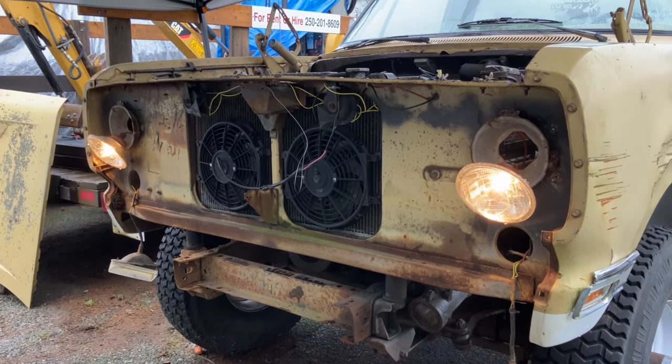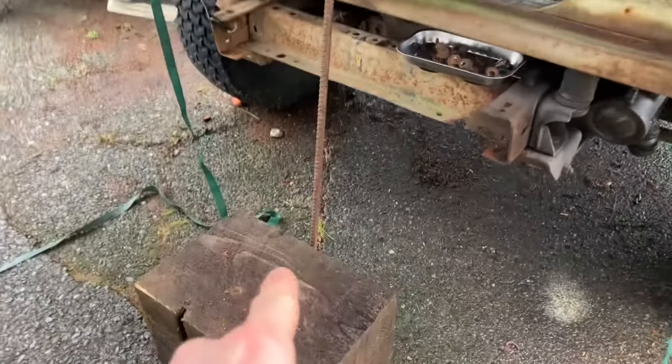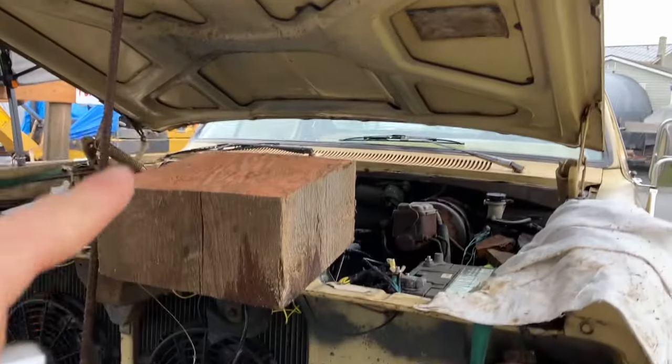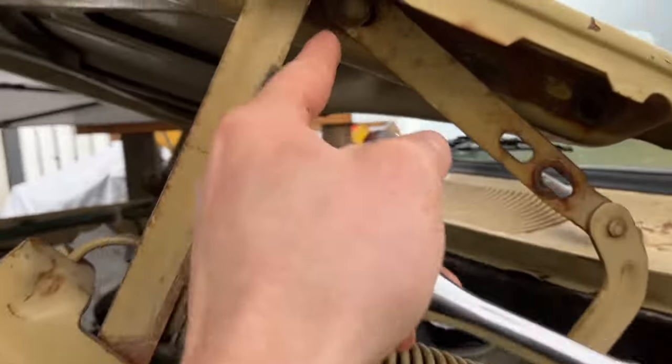Headlights are working. So to wrap that up — I didn't really fix the body line. I actually ended up making it kind of worse, but I did learn a whole bunch in the process. I learned how to take the whole front clip off. Side note: when putting your hood back on on your own, using a piece of rebar is great because it digs into the ground. You can put a block in front of it — it acts as your second hand. It locks in right under there. Before I had the rebar, I just had it on some wood and it kept sliding into the windshield. That block prevents it from kicking out. I got my first bolt in and I'm going to do the same on the other side.